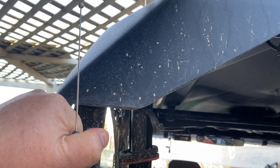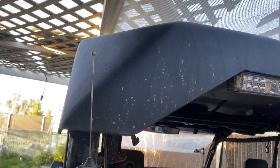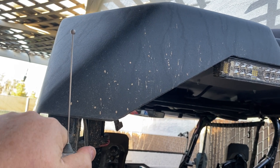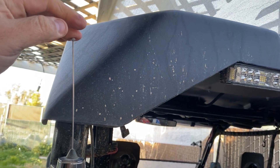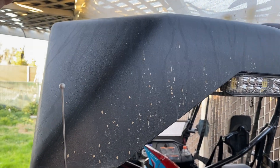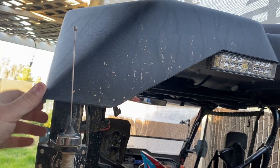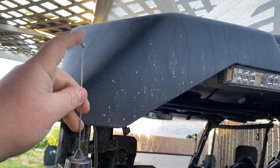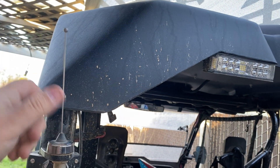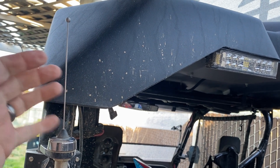Having the antenna set up right here, it's away from all the metal and it's down low so it won't get clipped. This is specifically for GMRS frequencies, but for VHF — especially if you want to talk over hills — you need something a bit taller. Make sure it's mounted so it doesn't get too much interference from the bar, and so you don't rip it off. If there's that possibility, consider adding a spring so the antenna can bend without breaking.